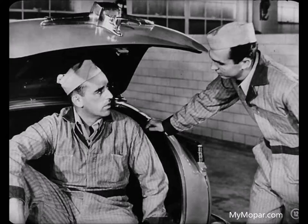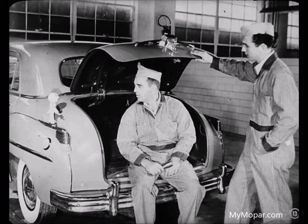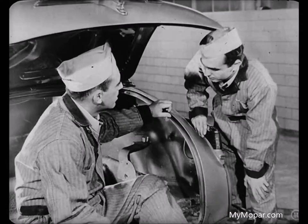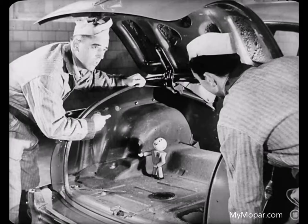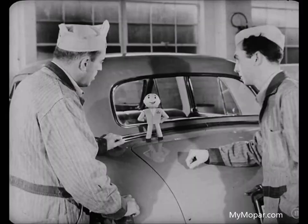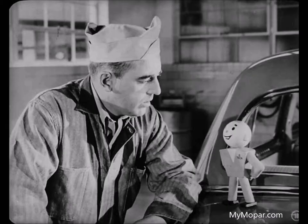Okay, hey, Tech. How's she look, Joe? She's tighter than a drum, Tony. You did a good job. How about giving Tony the whole story on water testing and body seals, Joe? A lot of mechanics I know are interested in water and dust conditions. All right, Tech. In this case, Tony said that his trunk leaked a little — some water was getting past the weatherstrip. We found a low spot by checking the seal with a shipping tag, so we tapped under the drain trough with a rubber mallet to bring the weatherstrip up where it belonged. While we were at it, I figured we might as well check the other luggage compartment openings, like the hardware holes, fender mounting bolt holes, and taillight mounting holes. So you went to a water test? Of course. That's the only sure way to track down a leak. Tony ought to know where these bodies are sealed, how they can be checked, and how they can be corrected.